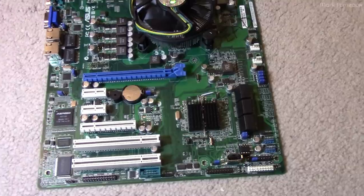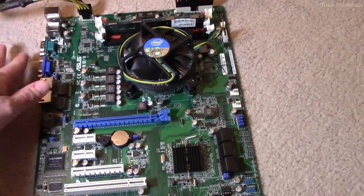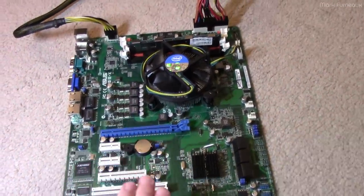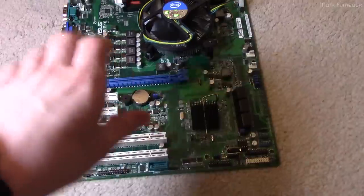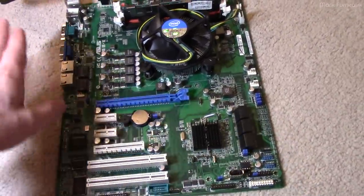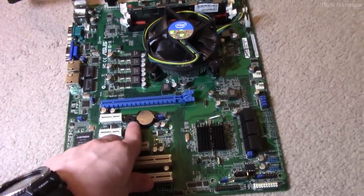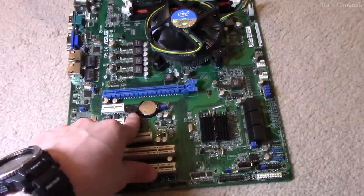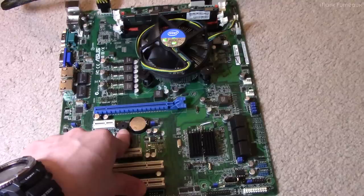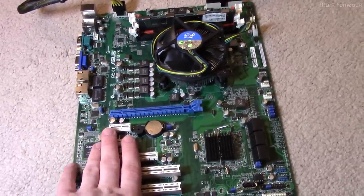I found a CMOS battery, and that's about all I need. I haven't bothered to put in a keyboard or a monitor, because the last time I saw this board it was borked, and I'm pretty sure it's going to be borked in the exact same way — I have very low confidence it's going to do anything at all. The reason we don't need those is because there's a PC speaker here, and this board will beep once when POST is completed. So if the board is working we should hear a beep — and I can tell you we're probably not going to.